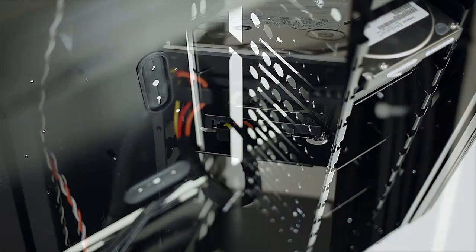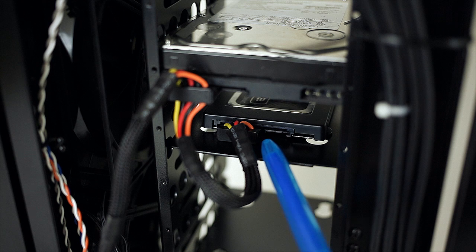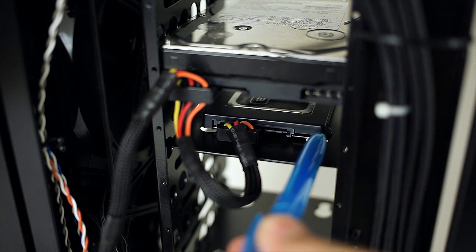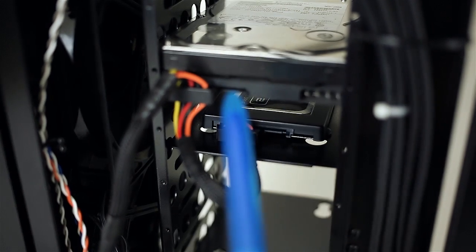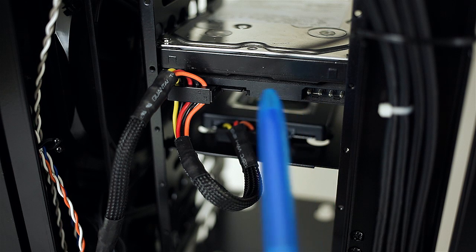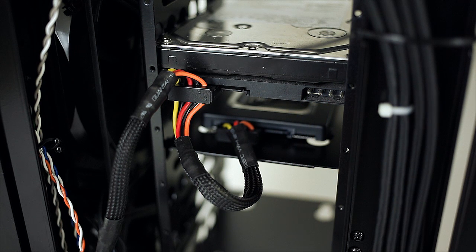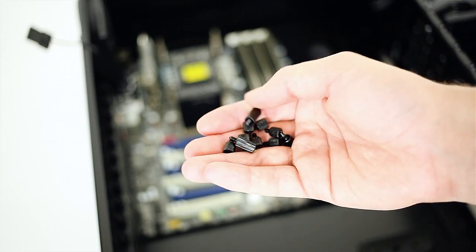And finally, probably the biggest issue is the clearance for those power SATA cables for the SSDs. The mounted drives are slightly more pushed in, so using only the end tip will allow the connector to fit. So there's plenty of practical issues with the drive cage, and we really hope Lian-Li can justify its future pricing, not on aluminum alone.